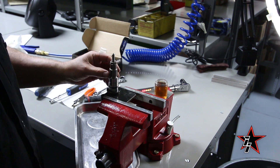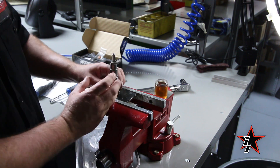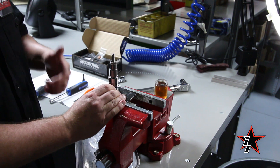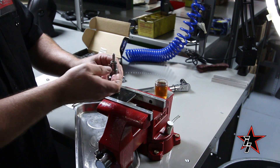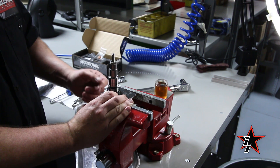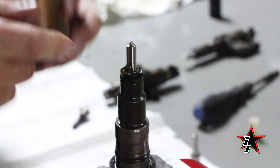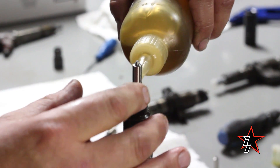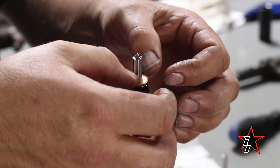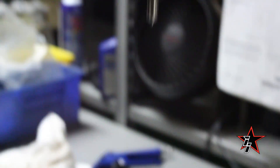No chatter — when you have chatter, you put a side load on the nozzle and that will warp the pintle and the nozzle. This can cause sticky nozzles, leaking out of the cap if not torqued properly, high returns, and many other issues — worst of all, motor failure. Please follow the torque specs we give you. Once it's torqued, I like to put a little bit of STP assembly lube — anything that's good and sticky — just press that on there, and now you're ready for install and it won't fall off.